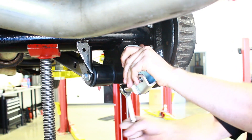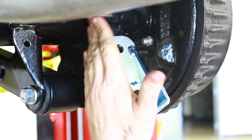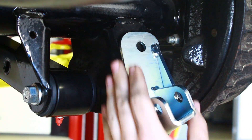After you get the lower bolt snugged up, it's important to set the shock bracket up perpendicular to the rear end tubes. A little tap with a rubber mallet will set you up square. Next, we're going to begin to pre-drill our hole.